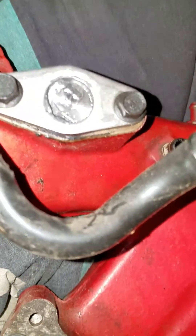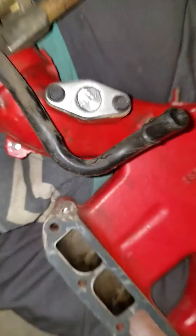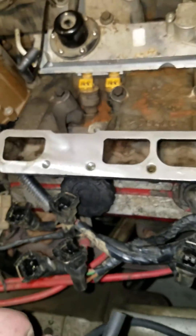The rest of it is just plugging up the intake manifold. I blocked off the EGR plate as well while I had it apart — look what I used: nickels, two nickels with black RTV sandwiched in there, worked beautiful. Fits just right. We cut the EGR tube off of it — it all lined up, everything worked out good. Put it back on and it should be ready to rock and roll.